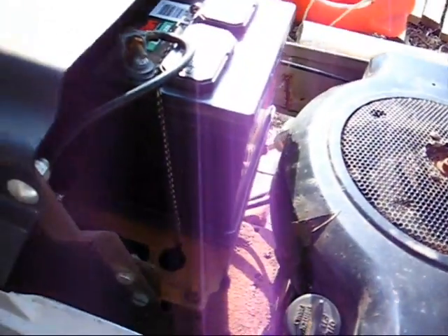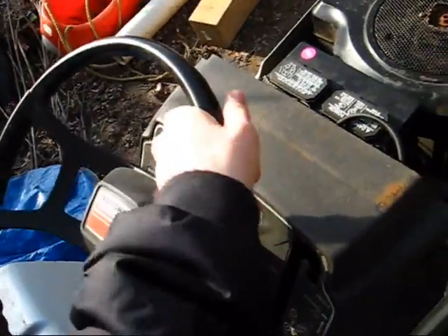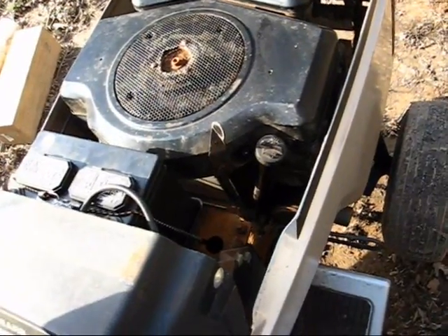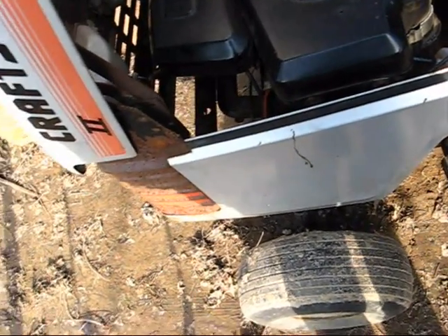The issue with the steering is they use a plastic bushing so you don't have to dig in there and grease it. The problem is the bushing is now the shape of an oval on the inside so this wobbles around a lot. I have a new bushing coming to replace it so that it's tight steering. I need to start this today because I think the parts are going to get here by Wednesday - today's Saturday. Plus I have nothing else to do.